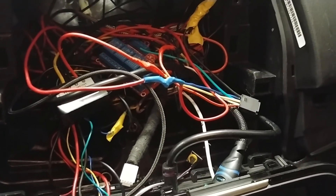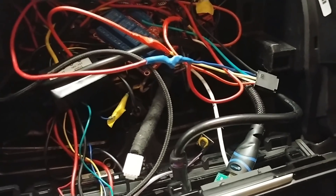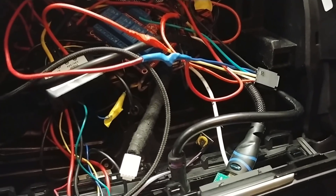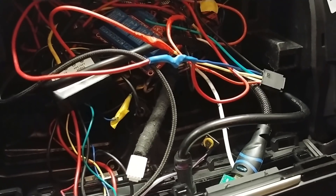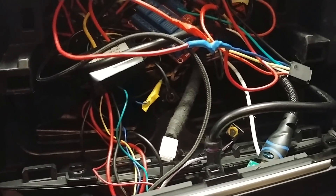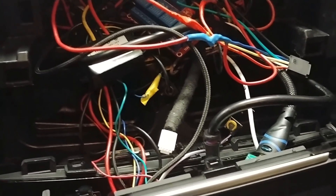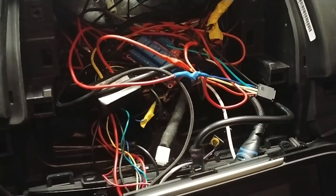I have now created a graceful shutdown. My car didn't have a delayed ignition like some cars happen to have, so the way to do it is basically creating your own with a combination of a timer and a relay board going to your GPIO and triggering a shutdown script. It's a little bit of work — in reality this probably took me a total of maybe a little over an hour, and 45 minutes of that was just figuring out how to program the timer. Once I figured out the timer, doing the actual wiring was quite simple. If you know GPIO and know how to set up everything else, Crankshaft is really simple because it already has the shutdown script capability built in — you simply tell it what GPIO pin to use. If anybody has any questions, feel free to let me know.